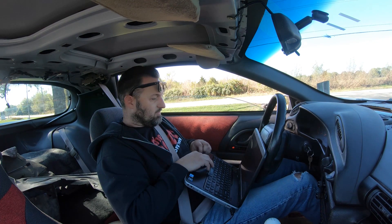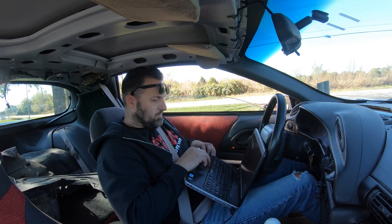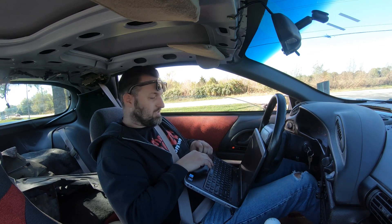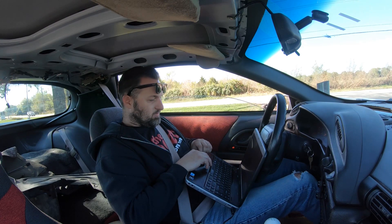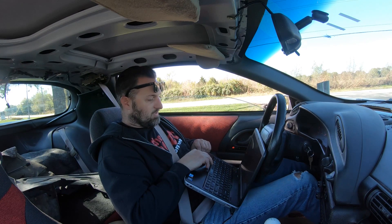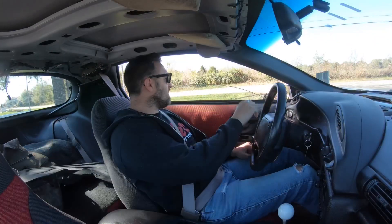I can see a little spike — it's on the rich side right there. One of the keys to doing all this stuff is smoothness. You want this graph to look pretty smooth — you don't want a bunch of peaks and valleys, you don't want it to look like an equalizer. It doesn't need to be all peaky; it's not gonna run great. Since this is gonna be a speed density only car, it really needs to be pretty smooth — it's just relying on the MAP sensor. Got it flashed — let's go for another ride.